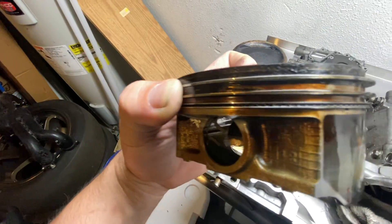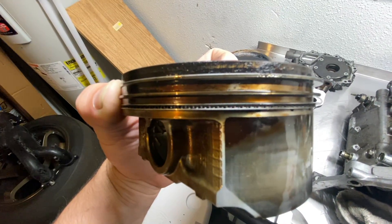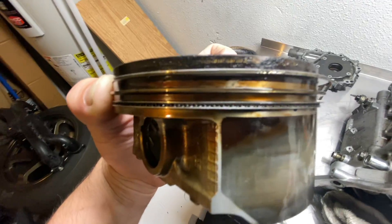The way a piston works: the piston has a skirt — this is what runs up and down the bore. The piston sits in there and as it rocks forward and back, it rocks against the skirt as it comes up and down. You have the wrist pin area, where the rod is attached through the bottom with a large pin that connects to the small end of the rod. The rings sit in these little grooves on the piston, and these are called ring lands because that's where the ring lands on the piston.